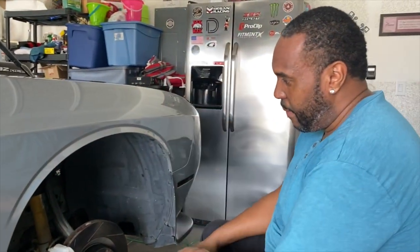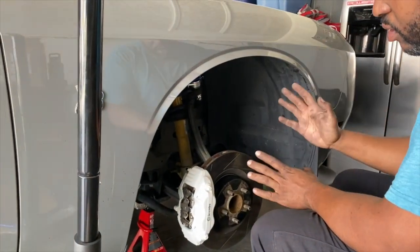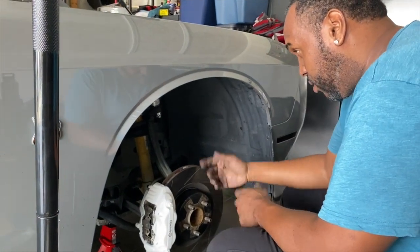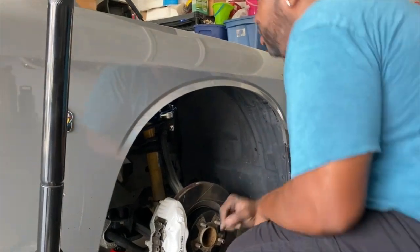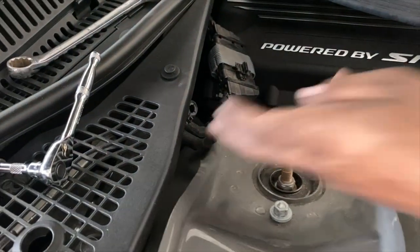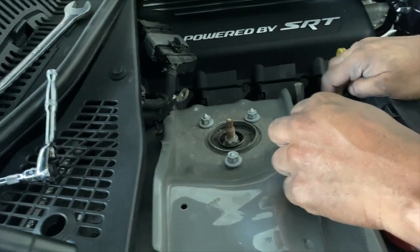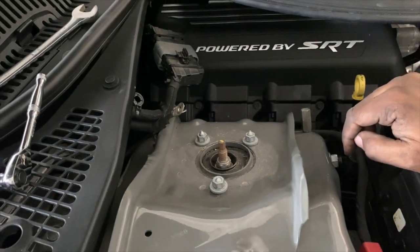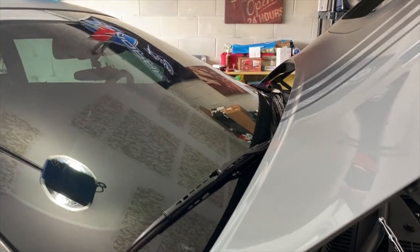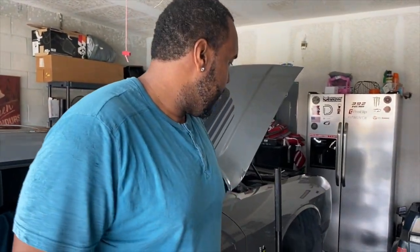Basically this has two bolts under the hood. What you're going to loosen is — well, you can take the strut out if you want to. I just loosen the sway bar end link, the brake line, and the upper ball joint right here — the upper control arm bolt. And then under the hood, one 18mm here, and on the opposite side of the strut tower there's another one. I have to take off the grounds on the car right here. You don't tighten these fully until the car's on the floor. So this bolt right here and the one on the opposite side, you don't tighten those until the car gets on the floor. And also these three here I did loosen, because you've got to pull the strut up just a little bit. So all this will be tightened when the car's on the floor. You want the suspension to be set as the car is sitting, not in the air.